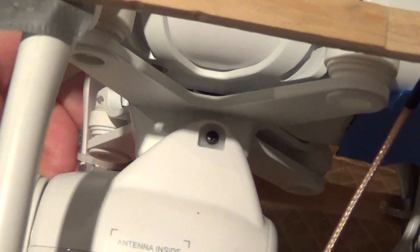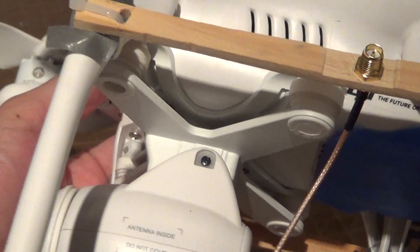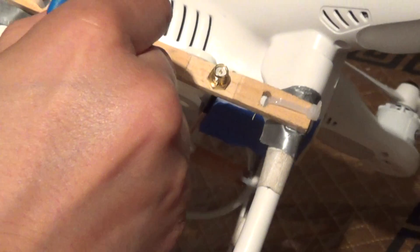You're going to need to pop off this little side bit covering the single screw. There's just one screw in here you need to undo. I'm going to pop off the cover here — and here is our little screw. I'm using a double-zero Phillips, although various sizes will work.